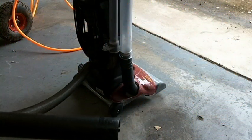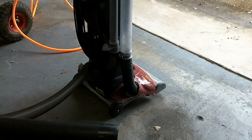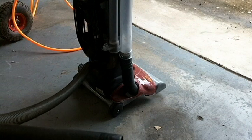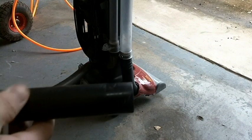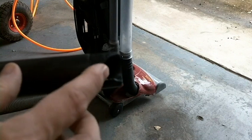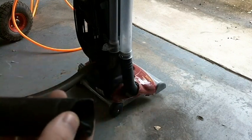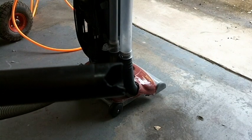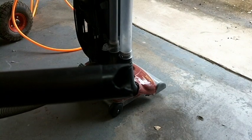I think we got most of the dust out. If you really want to get involved, you can probably start pulling those tubes apart, but I just shot some air through it and I think they look pretty clear. The only other thing — on this extension piece, through the test of time we've gotten a little crack here, so when you put stuff on there there's probably a little bit of leak. So we're just going to do a little Man Club sawing and take care of that.